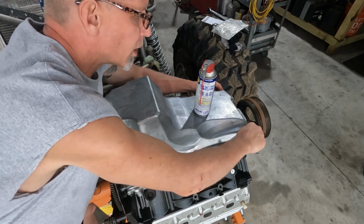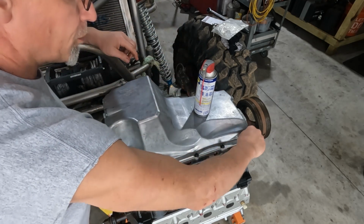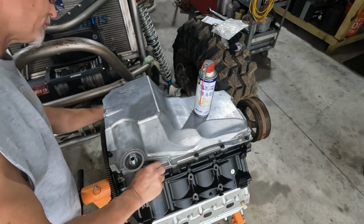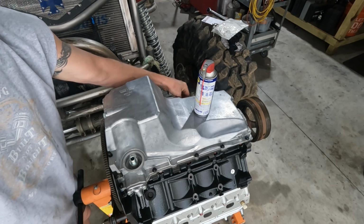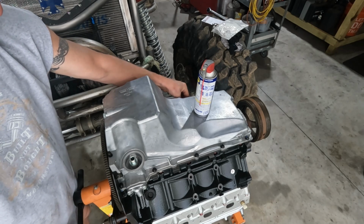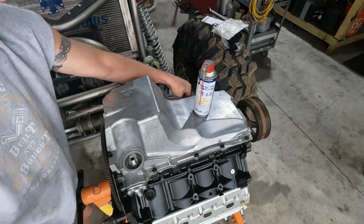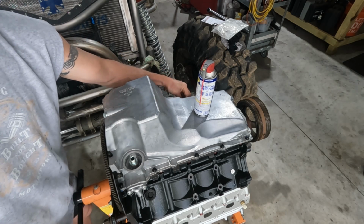I know before I said 11 and 22. I got that mixed up. That was the water pump that gets 11 and 22. This just gets 18 foot-pounds. That's what I get for trying to run off of memory and not data. I know everything. Always have. Just having a slight recall problem.